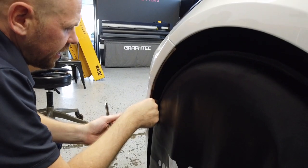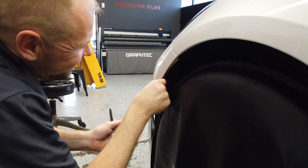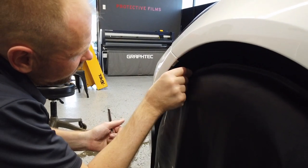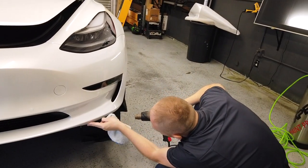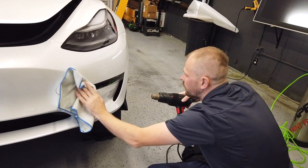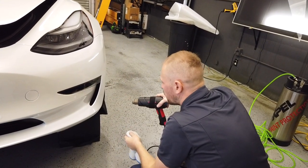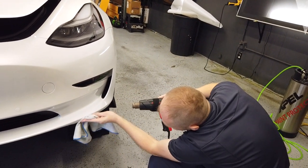See, I'm not cutting. I cut halfway through the material, a kiss cut, and then you pull it off. So the whole process, you didn't use the heat gun at all to stretch. You just use it to make the adhesive underneath dry, right? Mm-hmm. Like at the end.